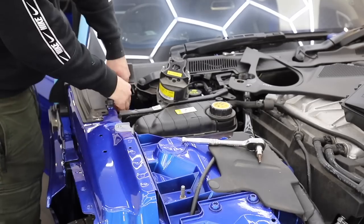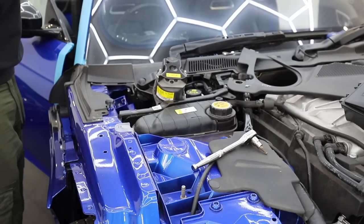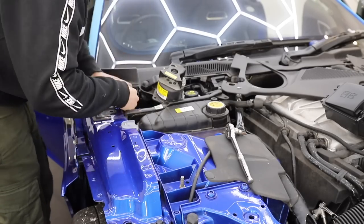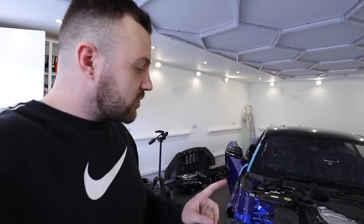One job down, on to the next one. Let's have a look at these bonnet release sensor things — these basically operate to tell you whether the bonnet is open or closed, and I believe they get damaged when the car is involved in a crash. Better to be safe than sorry and just replace them, so I know I won't have anything to worry about. After five minutes of spannering, that's done as well. Quick recap: we've got the dash out and at the trimmers waiting to come back so we can put it back in with the new airbag. We've got the new bonnet sensors in, the airbox on, and now we're waiting for a solution on the wiring for the headlight and MAF, and also waiting for the passenger side wing.